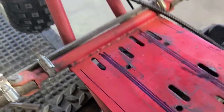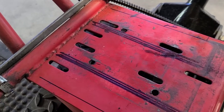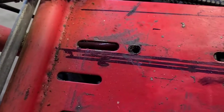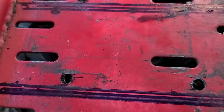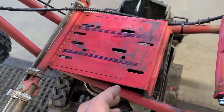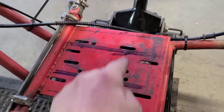I went back, and our bolts are going to be using these bigger slots. These little ones don't work. And these bigger slots are 1/4 inch. So I measured 1/8 to each side and laid out my channels. Now we're awfully close on this side. I might just cheat it this way a little bit. And since we left our torque converter loose here, we know that we can flop the washer, so we can get at least 1/16 more away from these holes over here.